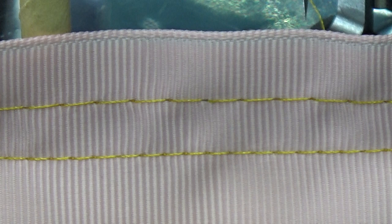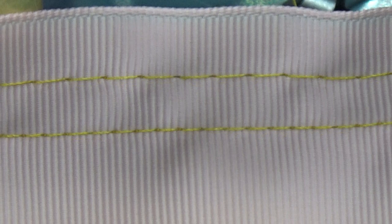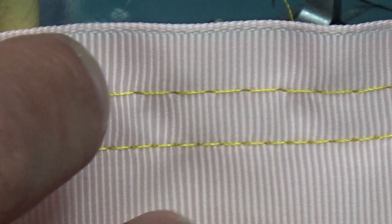It's not a dainty, delicate little approach. I dig deep into the machines, and the result is evident when you're doing a tricky sew-off like this with 100% polyester. The stitch quality and the caliber between both of those rows at different stitch lengths on a very slippery, tricky material is just absolutely spot on. Flip it over and look at that lock stitch.